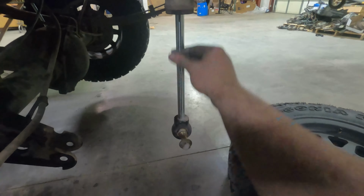Old Man Emu leaf packs on the eyelet actually have a separate sleeve that is pressed into the eyelet, and sometimes that sleeve can rotate and cause some squeaking noises. So that's one other thing to check if you're hearing a lot of noise on your Old Man Emu leaf pack. But we don't have those on our Alldogs packs, and it's relatively exclusive to the Old Man Emu packs. So that's just one more thing to check.